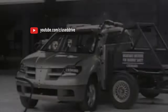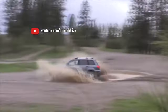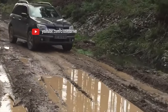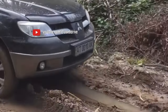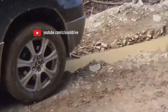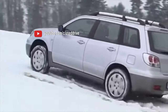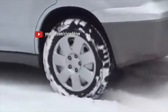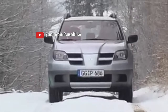Mitsubishi engines of this generation are considered among the best for creating powerful tuning projects, and in stock form they are very good, although they have some drawbacks. For example, they have relatively weak radiators, exhaust systems, and ancillary components. The basic 2-liter 4G63 engine of the Sirius family is not so common on the Outlander; it has a DOHC naturally aspirated 16-valve variant. The motor has a timing belt drive; the balancer is also belt-driven and the block is cast iron. The really weak point is that the upper balancer shaft is driven by a separate belt, while the lower one sits on the oil pump axis and is driven by the timing belt. Under heavy revs, the balancer belt load multiplies and, combined with worn bushings and oil pressure loss, this can lead to a broken belt or engine damage.